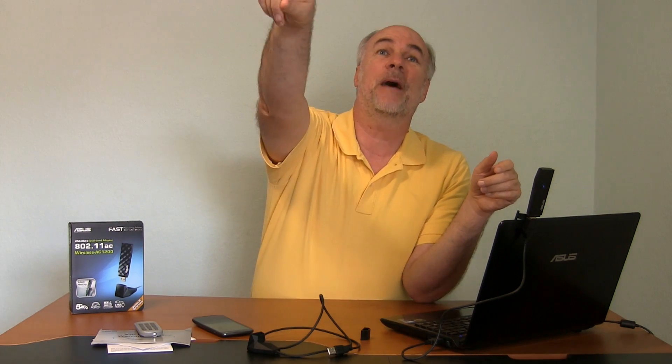That was rather inconclusive. Without another AC router or another AC USB adapter to compare, I don't know for sure. The numbers aren't as high as I was expecting running at 5 GHz in AC mode — they are better than they were in N. When I bumped up the router's transmit power, the range was really incredible — I was down past that house, past their backyard and fence, and still getting a reasonable connection speed. The issue we were having with our regular wireless N 2.4 GHz network — the dropouts, stuttering, and buffering — all seems to have gone away since I installed it. And the distance capability of 200 to 250 feet suggests this router could be a good choice if you have a big house with dead spots in your Wi-Fi.